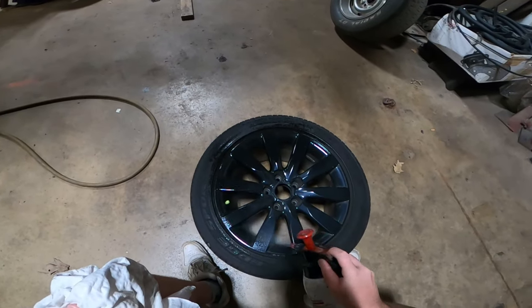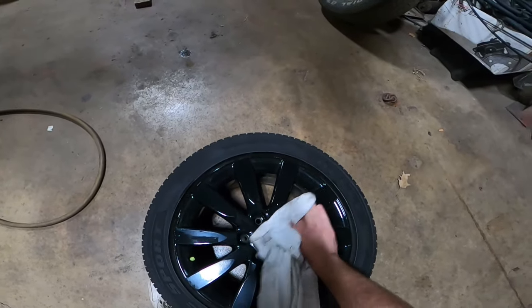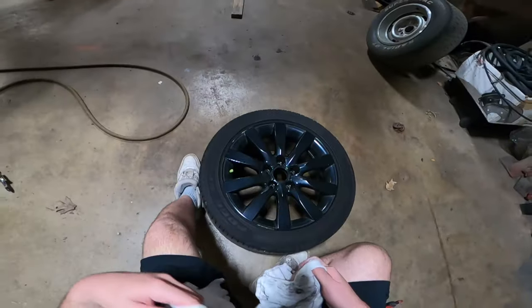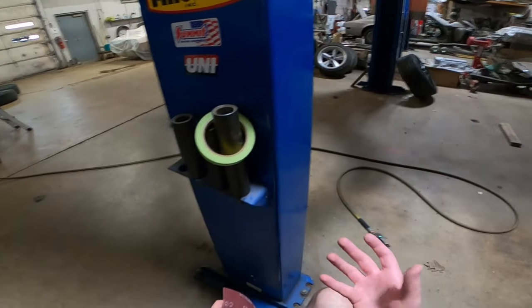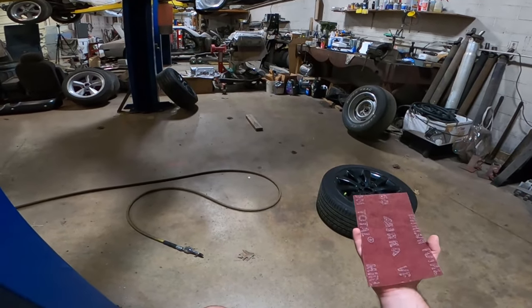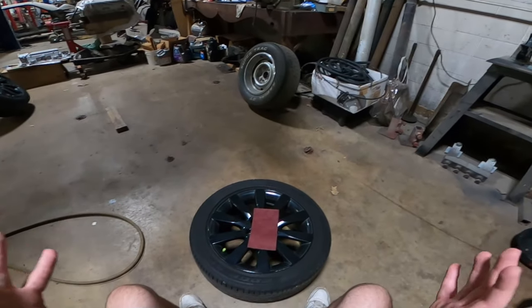We're gonna give it a quick pre-scuffing pre-soak. It evaporates relatively quickly, so you don't want to let it sit on here for over 30 seconds without touching it. I used to actually sand them in different grits, but it really isn't worth it - it's so much easier and so much quicker to just use a scotch brite. Use a red scotch brite - obviously different colors mean different grits - and scuff the wheel as thoroughly as possible.